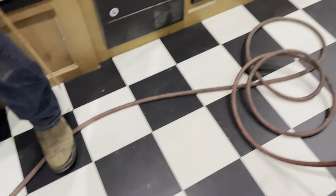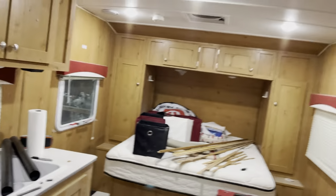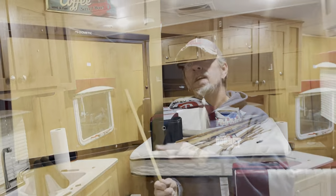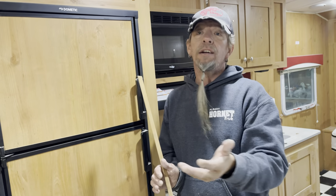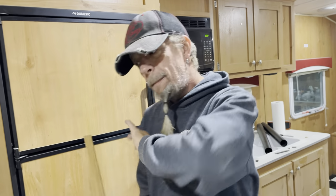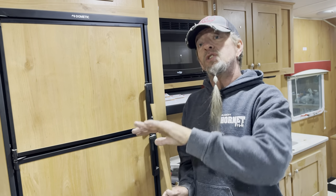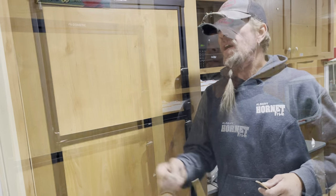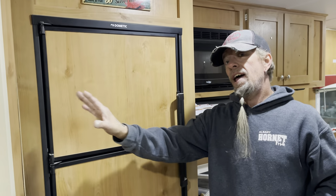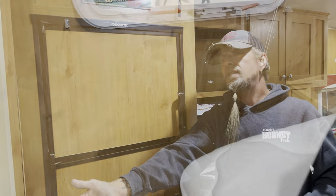Before we let it go, I'll go around and reseal that whole back wall. We'll look at that back rail where your roof transition comes off onto the metal. We'll go through and clean to begin with so that whatever we're resealing has a real clean surface. A lot of times techs are in a hurry and will just come through and seal over it. But that solvent makes sure it's a proper surface for the silicone to re-adhere to. Any place there's a penetration on that wall at all: the marker lights, that water inlet.